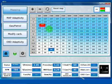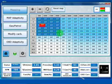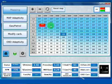The values you see here in the map mean the amount of gas we use for injection, and it's referred by RPM and petrol injection times. We calculate this map during the auto calibration, and you can change it later if you need to make some adjustment. The auto calibration does not cover all the times and all the sections of the map, because it's made on idle, so we don't have all the information about how the vehicle is running in all conditions.